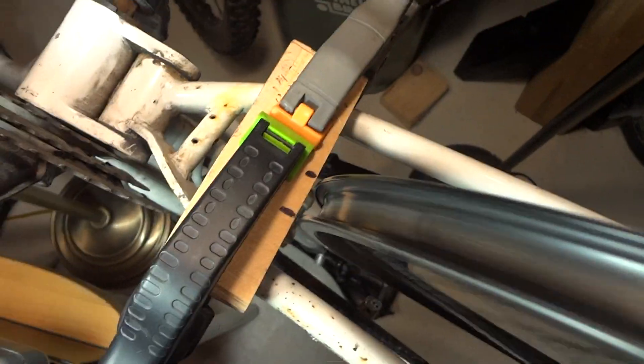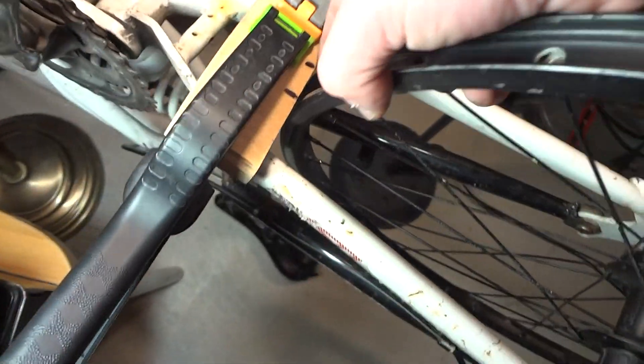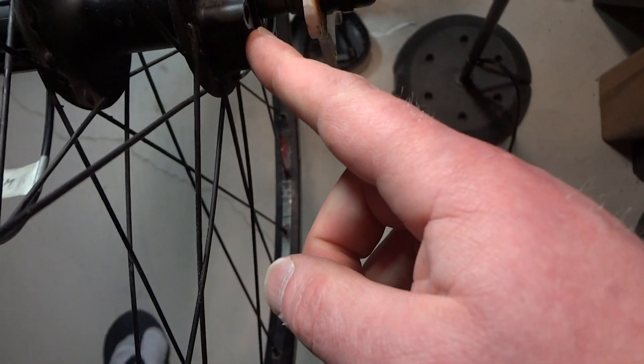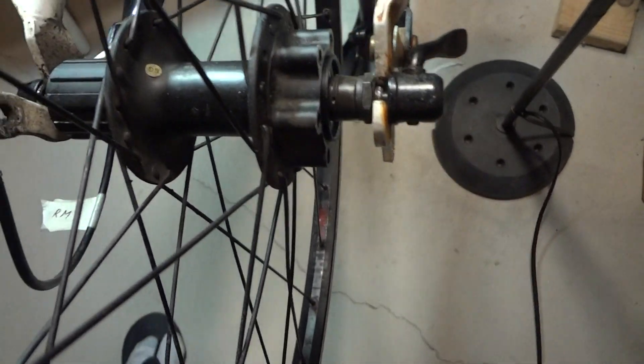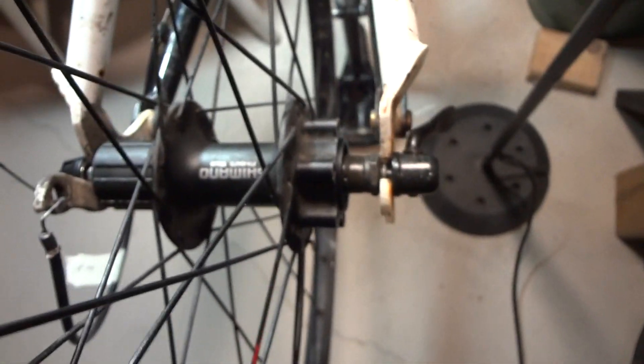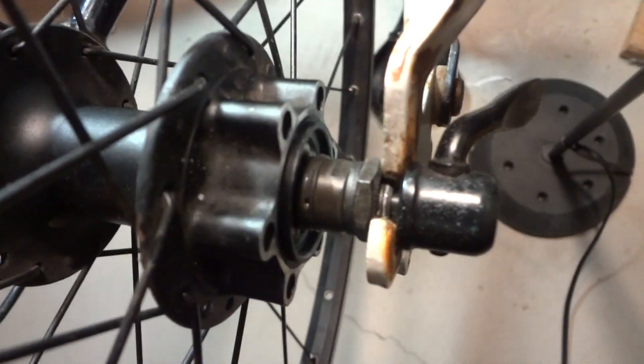Considering it's missing two spokes, that looks not that bad. I just tightened up the bearings — there's almost no play on this. The reason I'm running here with no grease is because the bearings, the race, and the cone are totally pitted and destroyed. So I'm turning this thing in both directions as fast as I can, and it's actually getting smoother. What I'm trying to do is sort of machine the race — I don't care about the bearings or the cone, I can replace those, but I'm trying to machine that race because I couldn't hammer it out.